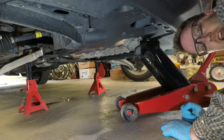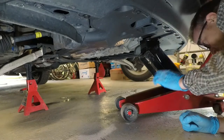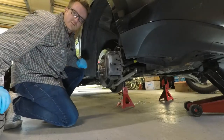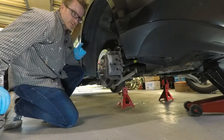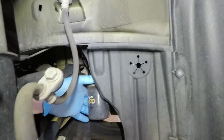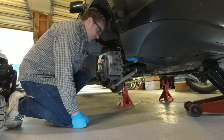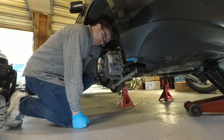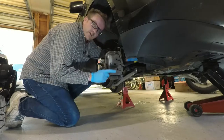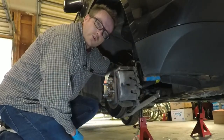Not tight — just lightly tensioned enough that there's hydraulic pressure in there so that if something slipped it's not going to risk blowing out a seal when it lands on it. The advantage of doing the oil and filter change at the same time as the tire rotation on this particular vehicle is that the oil filter is right up in here and it's very easy to get to while the front tire is off anyway. You also want to check your brakes — I can see these fronts still have some meat on them, but they've probably only got about another 10,000 miles, so I should make a mental note to do those soon. I also know these rotors are slightly warped because I get a shimmy when I brake.